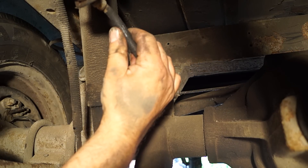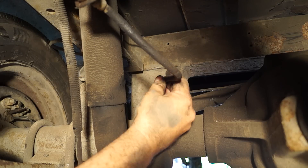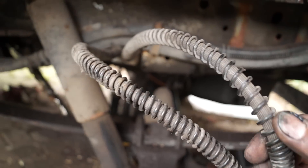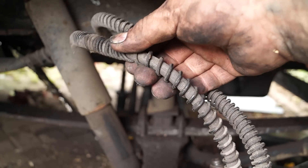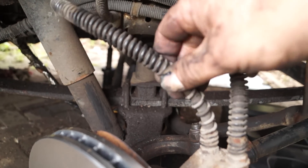Checking the condition of your brake pipes — which is your flexes and your metal pipes — is very important. You don't want any nicks or cuts in them or bulges. This is a failure on MOT, so they're worth inspecting very carefully and thoroughly.